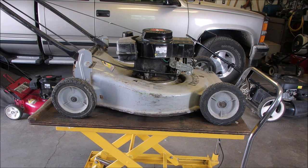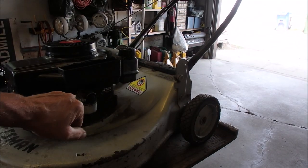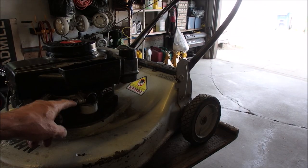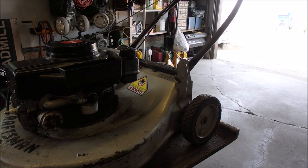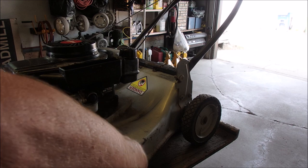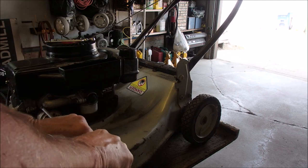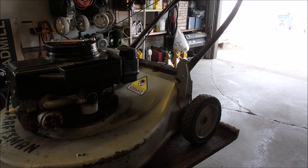I did spray some carb spray on the back over here, and I got some sputtering, but don't forget the throttle shaft is right on top there. I'm going to tighten up the intake manifold bolts and see if that helps me. 3/8 and 7/16, eh? And the big Phillips screwdriver for the intake bolts. You just never know, eh? Hotter than a pistol now, I gotta be careful. Hotter than a $2 pistol.